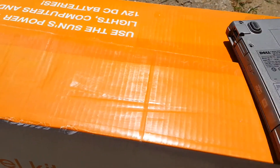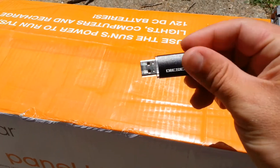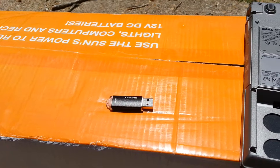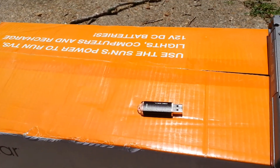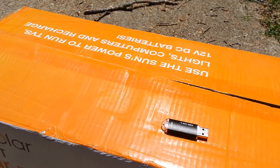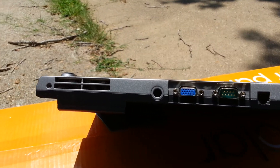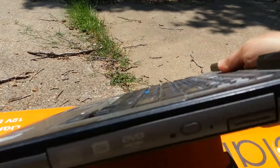I'm actually going to pull out the DVD drive — no need for that. And I'm going to run the operating system on a thumb drive. I've had really good success running Linux distributions off this machine. Probably a 4-gig; if I get fancy, I might throw a 16-gig in there. One thing to be careful of: the USB 2 port is on the back and there's only one of them, so make sure you don't use the side ports.